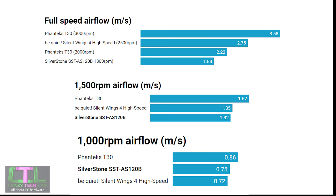A really surprising result was that the Silverstone actually beat the Be Quiet at the 1000 RPM airflow test. I ran this test several times, making sure the anemometer was reading maximum output from the radiator and double-checking the RPMs of both fans. They were both running at 1000 RPM, and amazingly the Silverstone managed to beat the full height Be Quiet fan at this speed. Overall though, the full height fans and the Phanteks do generally perform better once they spin up, and I can say that's pretty much across the board since the Silverstone is about the best slim fan I've tested.